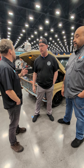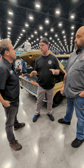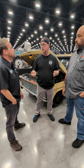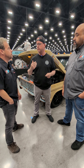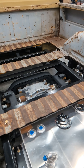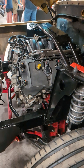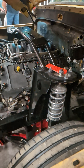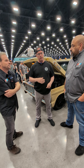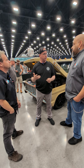It's a great solution. Somebody comes to you and says they want to do this — what's their cost? We sell only the chassis. I leave it up to the customer to source their front and rear suspensions. The chassis is $7,500, and you get the full chassis ready to bolt on the entire truck with the entire suspension hardware included. For the front suspension you actually have a lot of choices. You can go get the whole dropout from a 2015-up Mustang — the K-member and everything — and it'll bolt right up. It has the little ears that go out; we tell you to cut those off. You can use the factory struts from the Mustang. It's got electric power steering, the big 14-inch brakes right off the bat, and all the aftermarket support — big sway bars for the Mustang and everything available for it.